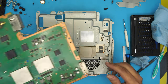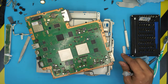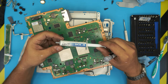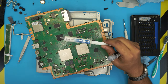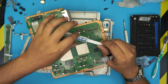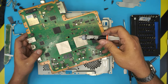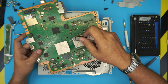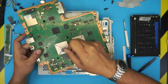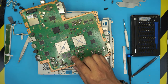Do another pass over the CPU and GPU on the board. For thermal paste, I recommend Arctic MX4 or Kryonaut Grizzly — Kryonaut is the premium option, MX4 is a great second choice. For this demonstration I'm using a generic paste. Apply a cross-line pattern: one small line across horizontally and one vertically for the GPU, then the same cross pattern for the CPU. You can use this method with any thermal paste.